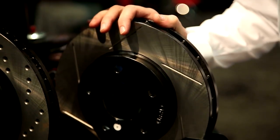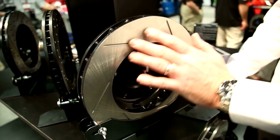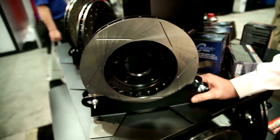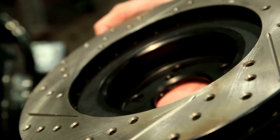When choosing between a slotted, drilled, or a drilled slotted rotor, it's important to understand the usage model because that's going to be what decides what's best for your vehicle. Slotted rotors are recommended for a high-performance street application or heavy-duty application if you're towing and hauling with a truck. Drilled and drilled slotted work great in cold and wet conditions, specifically when temperatures are low and the brake pads need some help to work at their optimum temperature.